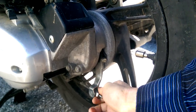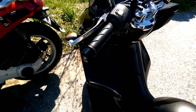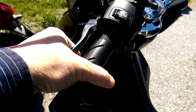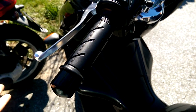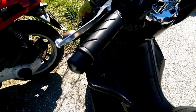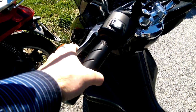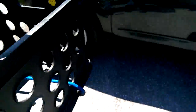First off, just make sure that your brakes are adjusted and that you have a reasonable amount of free play in the lever or pedal. In this case, obviously it's a scooter, so it's got a brake lever. I think that's a decent amount of free play. The service manual will specify an exact amount of free play; however, you want to go by what you feel — make sure that you're feeling the brakes, not too quickly, but quickly enough that you're able to respond.